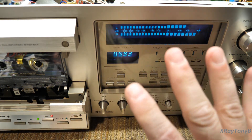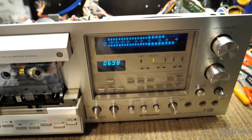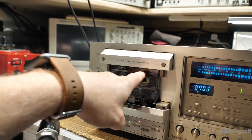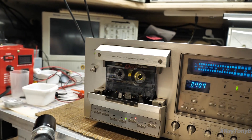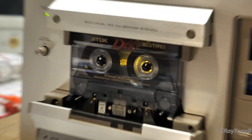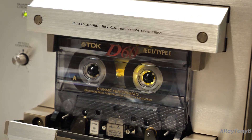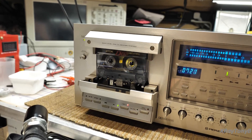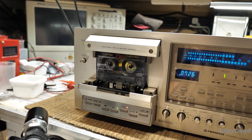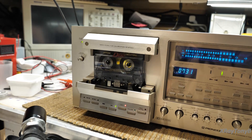And that's the bias adjustment for the normal cassette. I'm using my TDK D60, IEC1 Type 1. Pioneer had a very specific normal tape formulation, and I heard this is pretty close to it from comments from other viewers, so hopefully it'll work.